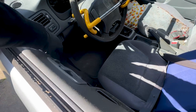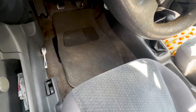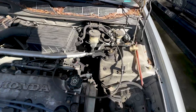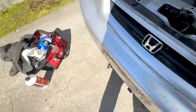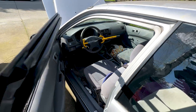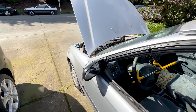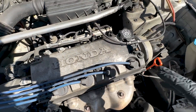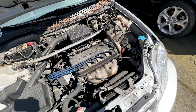On top of that, the brake fluid is very low. Let me pop open the hood and take a look. The brake fluid is very low, so I brought some good old DOT 3 and I'm gonna throw that in there - not a biggie. Down here I see a bunch of bolts. Why is that? Who knows, man. Isn't there like a bracket or something that goes up here? Maybe one of you Honda enthusiasts can let me know down in the comments.